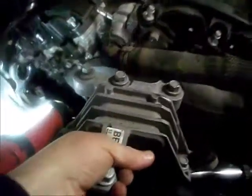I set the engine on a jack, with a piece of plywood separating the jack from the oil pan to cushion it. Now I'm going to take the upper mount loose. I had to raise the motor up a little bit to get it out from underneath that water outlet and hose, but it seems to be moving right along. Looks like some 18 millimeters in the front and back, and one in the middle. And the rest of the mount.